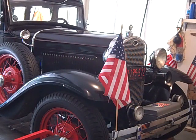That's not easy to do, find a hoist, or lay under the car and look at every wire, everywhere it goes, and look for frayed wires. You don't need a short. A lot of the wires are probably going to be old, and if it goes across a sharp object, then tape it to protect it, because there's a lot of vibration with the Model A, and it can work through a wire pretty good if it's rubbing on a sharp surface.